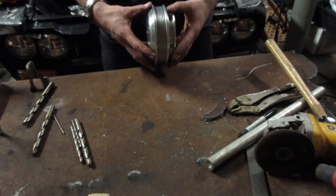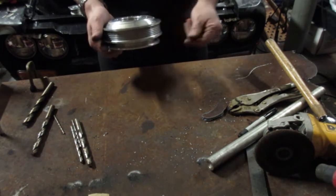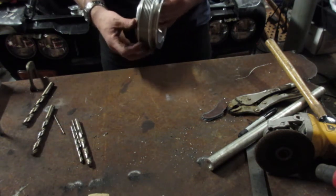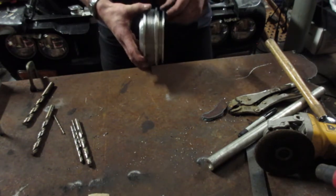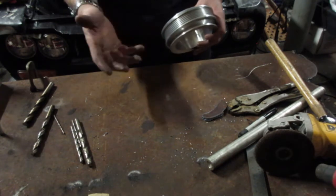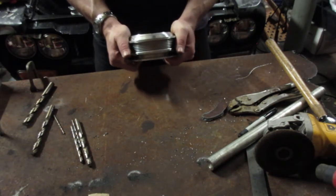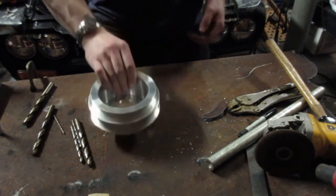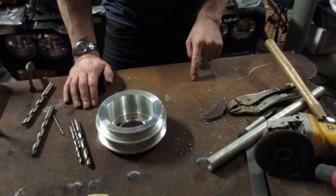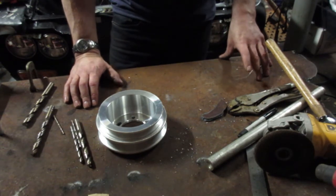I do need to double check the maximum impeller speed on this old supercharger. I want to say it's 42,000, so we'll be well within the operating range of the supercharger itself. It just remains to be seen how much boost we will get at roughly 36,000 RPM, basically at peak RPM, or where I'll end up shifting. Obviously I can get different pulleys for the supercharger itself, but the thing we'll run into is having enough wrap and friction to avoid slippage when you get to the higher boost levels. It just remains to be seen.